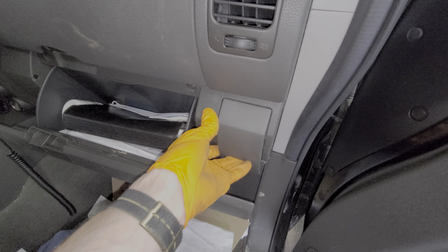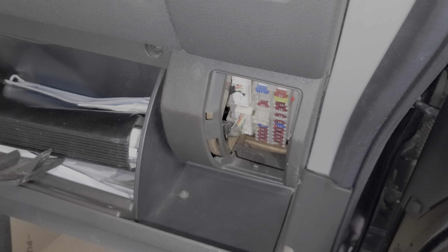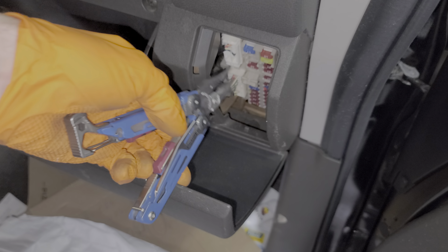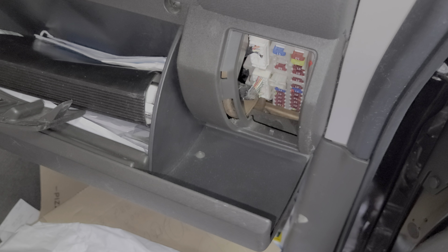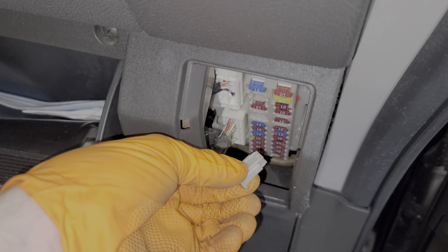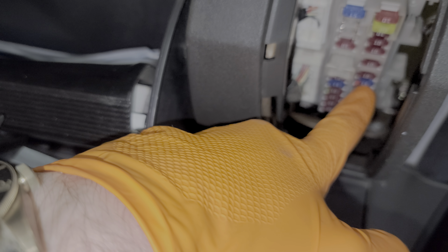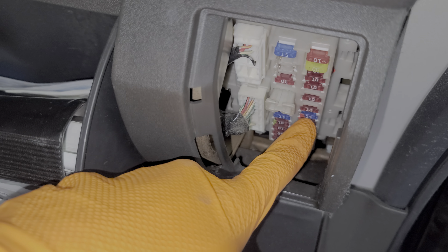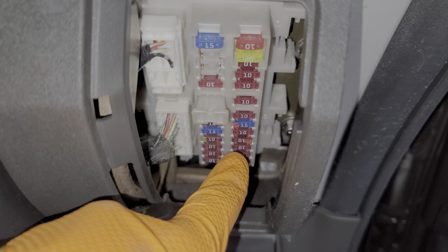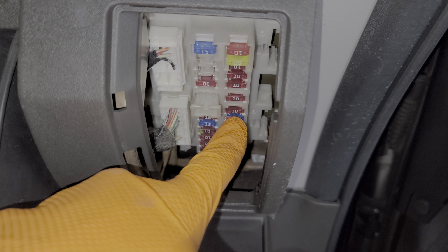To open this up there's a tab here we push in while we lift up on the cover, and another tab here. So let's get this cover out of the way and in here we can find that fuse. For those of you who are rewiring or installing a different head unit, this provides power on a yellow wire and that power is constant. Whether the car is on or not you should see constant power coming through on that yellow wire from our 20 amp fuse.